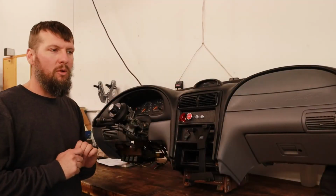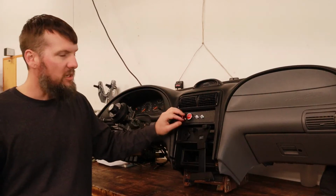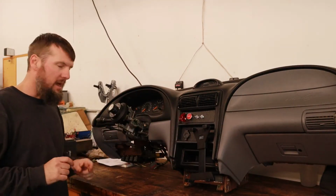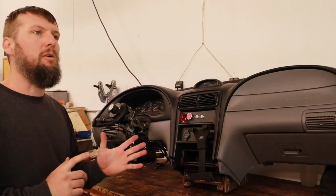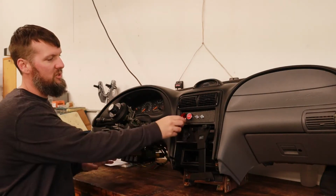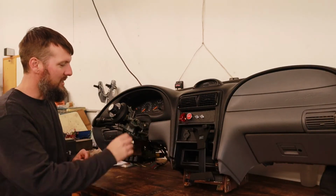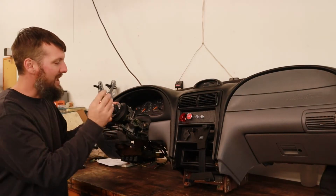Alright, I wanted to just give a quick addendum to that last video of doing the ignition switch and push button start. One thing that I kind of forgot to mention, because I actually removed it from the car many years ago, is the steering lock. So if you remove the ignition switch to be able to put it on switches and push button things, you would still need the key in order to release the steering lock. So that can be removed.